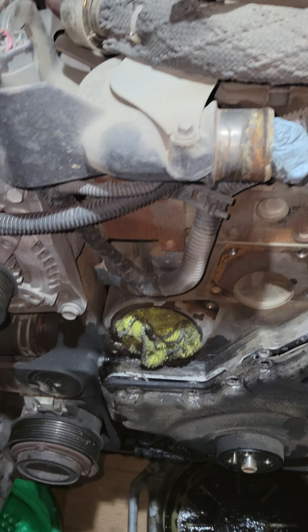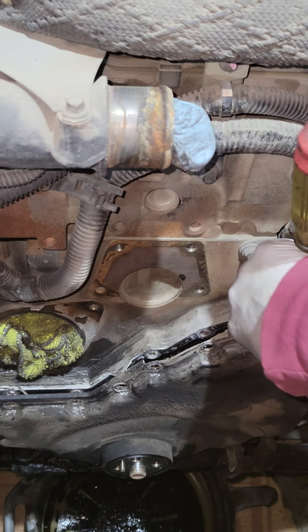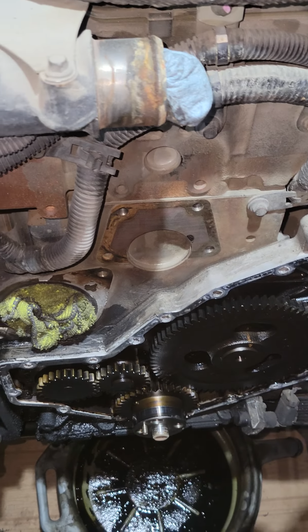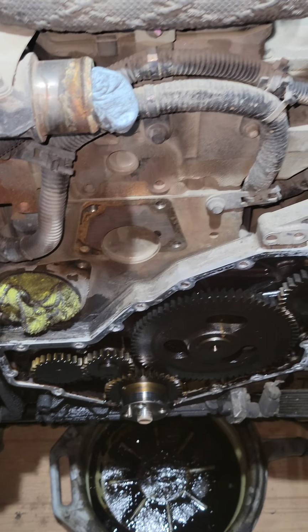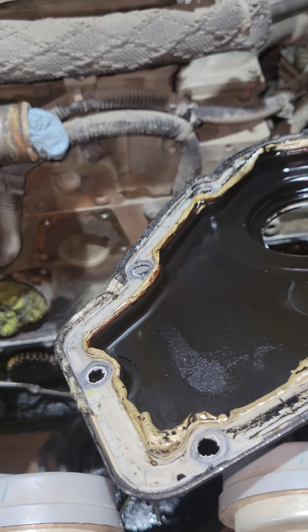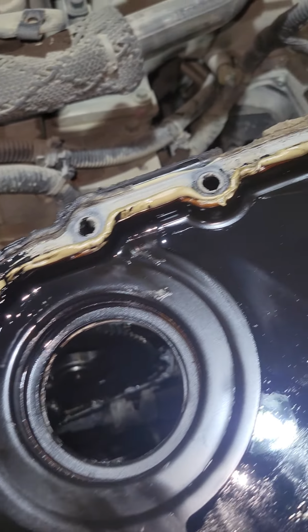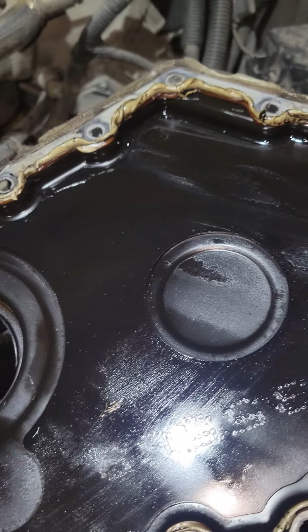What you're kind of fighting is the actual front main seal up there. There it goes. It's off. And I'm wrong. That is 12-year-old silicone. It might smell like it's not, but that's definitely 12-year-old silicone. You could tell by the discoloration. That's years of oil getting on there. So definitely is. But as you can see, there it is. Those are some very ugly gears.